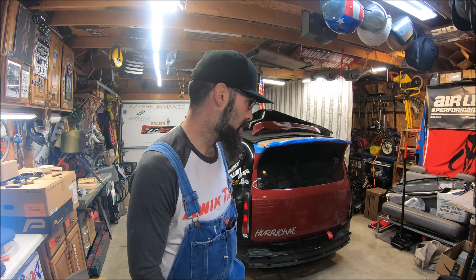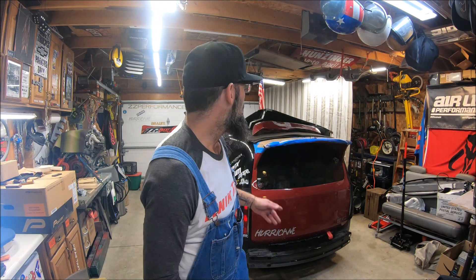I was really hoping to have it done this coming summer for the River Valley Road Rally again. I missed last year because I had taken the car apart — figured it wasn't a good idea to run it without reverse, which was all part of the plan. Taking the cradle out meant taking the transmission out. The cradle in this car originally only had about 4,000 additional miles over the other one and had a perfectly good working transmission with reverse, so I just swapped the entire cradle. Switching to an F40 simply made sense — swap the cradles, put that one in here, and take the transmission apart. All my other miscellaneous parts are in storage waiting to get pulled out and the car put back together. I'll be doing the full interior and will need to redo a new headliner to incorporate the Mini Cooper roof as well.